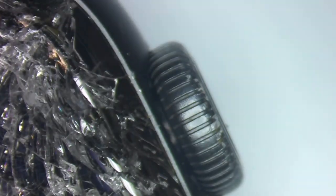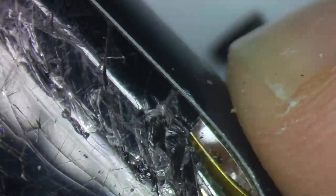This is a Series 6 44 millimeter. The first thing I'm going to do is start to isolate certain pieces of glass that want to come out. These are going to be shards of glass on the border that aren't adhered completely to the display. Using a versatile pick mixed with some isopropyl alcohol and a few other methods, over the course of about 20 minutes I'm able to extract all of these shards of glass from basically half of the watch.